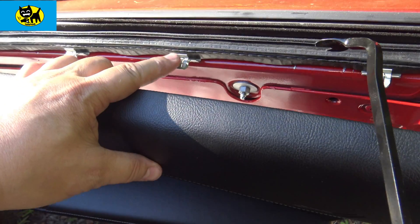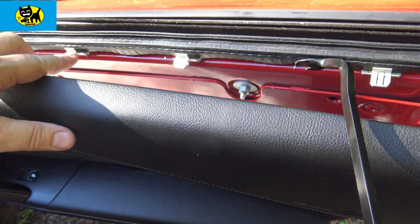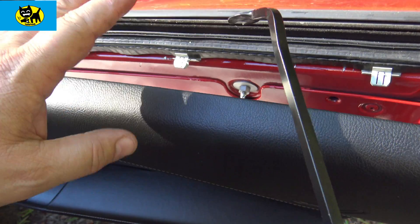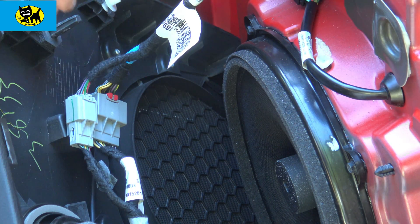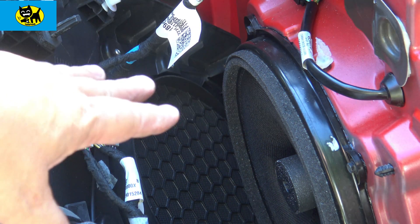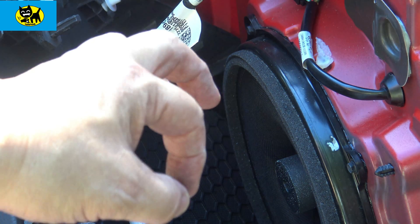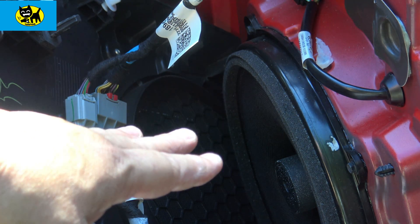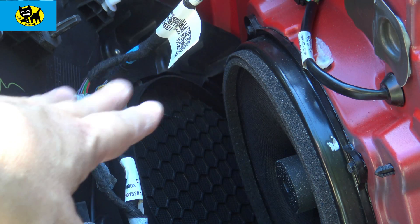Here's a quick shot of those metal clips I was talking about. Personally, I find these the hardest, so it's good to start with these. You don't want to break these — they are fastened into the car, so this part is going to stay on the actual door, and it will pop out from the little holes in the actual door panel. Much like the driver's side, there are actually two clips you'll have to work with: there's a gray clip, which you just push in and pull out, and a red clip which is a little trickier. When you pull the red part up, then go ahead and wiggle it out. Some YouTubers show pulling the whole red clip out, but in my case the red clip did not want to come out — the clip did become disconnected once it was pulled upward. I didn't want to break my clip, so if you don't have to remove the red clip, I wouldn't. The locking plastic mechanism stayed in place, and since it's plastic, you don't want to break it. Be gentle, take your time.